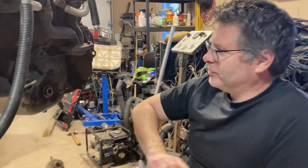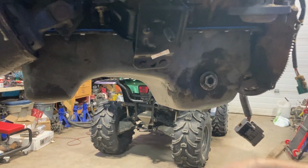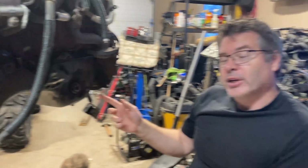Moving on. All right, let's update you on the progress with the Mustang. So what we've done so far is we've changed the oil pan because we had to get the Explorer pan off, get this Mustang one on there. The other thing we've done is we've taken off the mounts and put on these mounts for the Mustang. So with all that in place, we're ready to try to drop this into the car. Let's see how that goes.